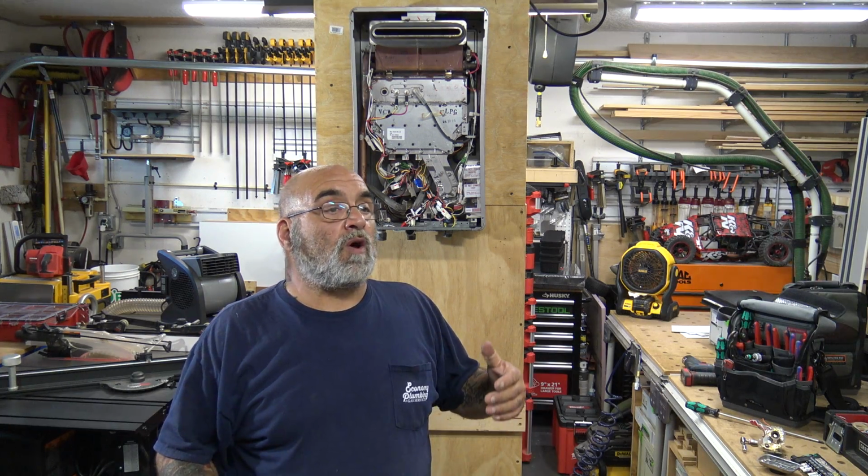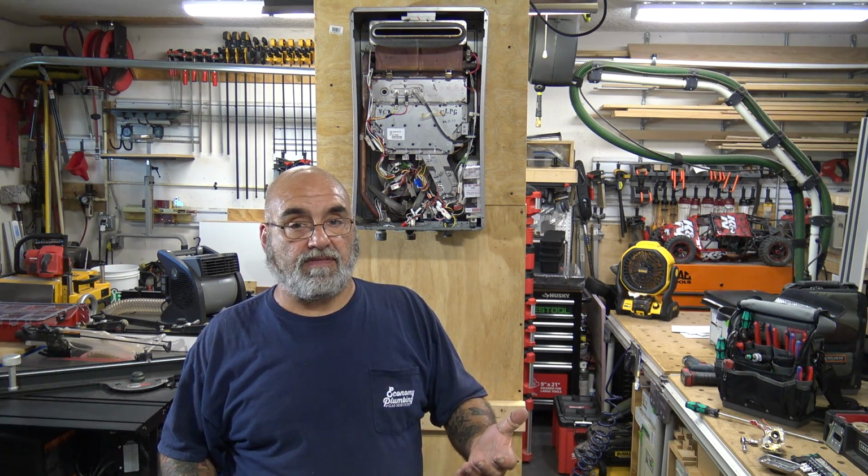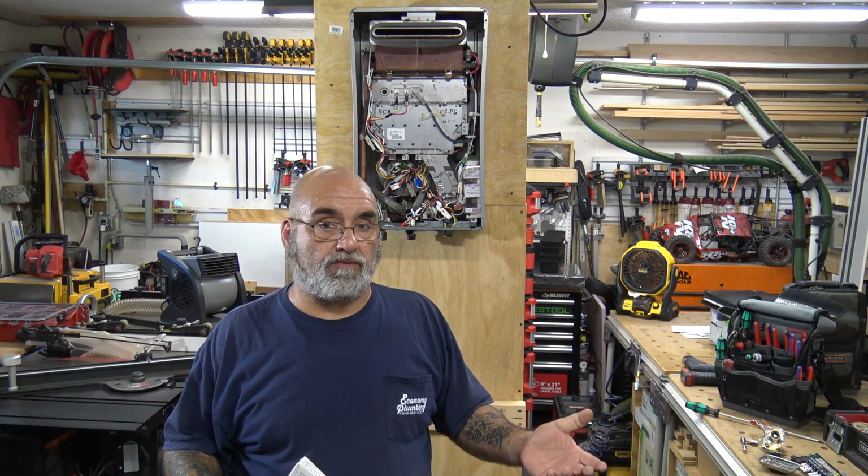If you don't have this, somebody took it, all you need to do is call up Rinnai tech support, give them the model and serial number, tell them you need a water servo valve, and they'll give you the part number. And you know, whether you can buy it from Rinnai or from a local distributor.